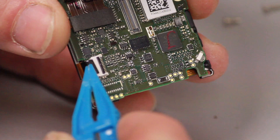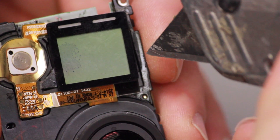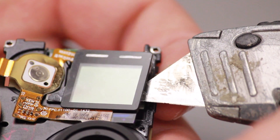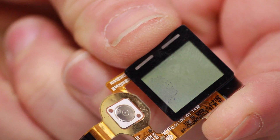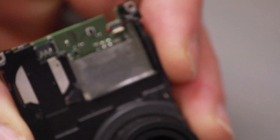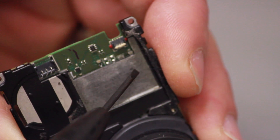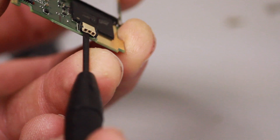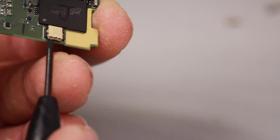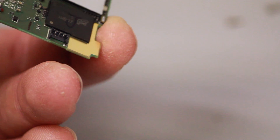That mistake changed my process, so I'd suggest you take the LCD screen out first and pry it up from its double-sided tape. I missed that on video, but be careful — I was moderately careful and still broke the LCD a little bit, though that's okay since I always use the app or connect through the drone. The connector there has a toggle and slides right out; the other one pries straight up and out from the other side.